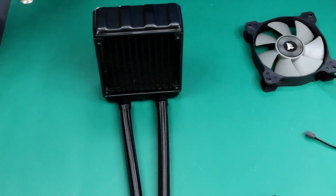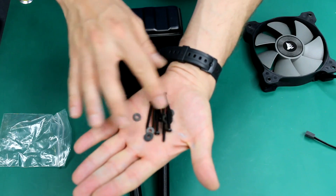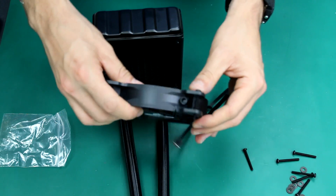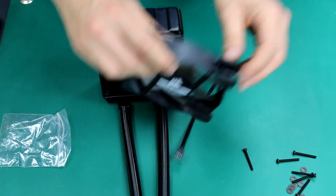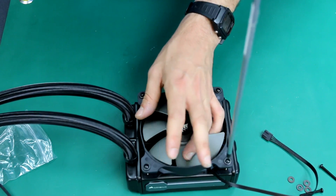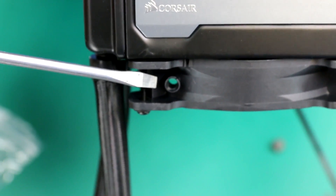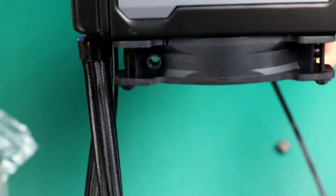Let's install one fan for now. We're going to need another set of screws — these ones. They are very long because they need to go all the way inside, and this part needs to be anchored to the radiator. Don't force the screw too much; when you feel you have reached the bottom, just stop or you're going to break the fan. Now the fan is in place. You can see the arrows telling us the fan is spinning and blowing air towards the radiator.